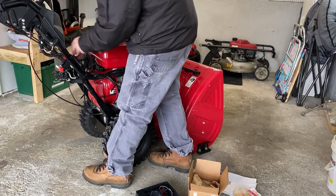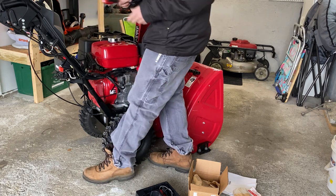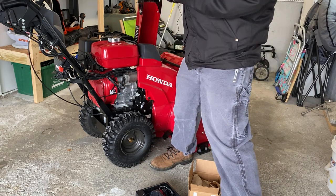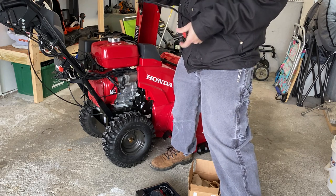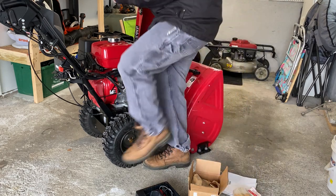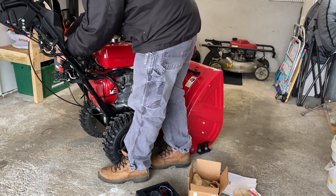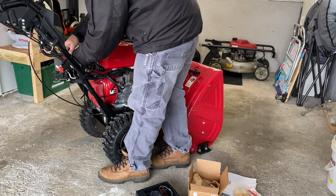It just fits perfectly. So I'm gonna do black first, that's what it said. Before I do that though, I'm gonna use these. These came with the battery tender. So you can put these on and I can charge it whenever I want. I'll show you after. Yep. So red goes to red. Let me put this down for now. Red goes to red and black goes to black. You wanna do the black first, it said.